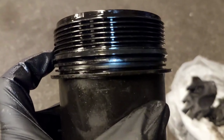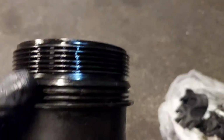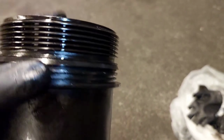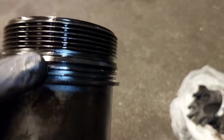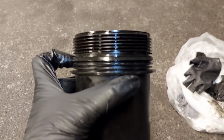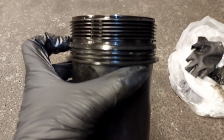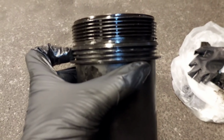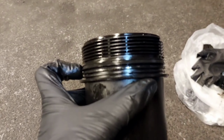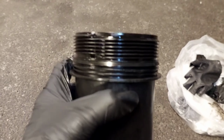Now when you're replacing the rubber gasket seal around the engine oil filter, just make sure that it's not distorted. Usually it is when you put it on first. First, just smear it with oil from inside. Take some oil, put it on your fingers and smear it all around. And if it's kinked, if it's twisted, just get an ordinary screwdriver, put it up underneath the seal, and run it around 360 degrees, and it will remove any of those distortions. So you don't want any kink in that.